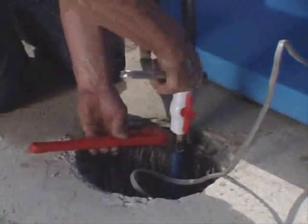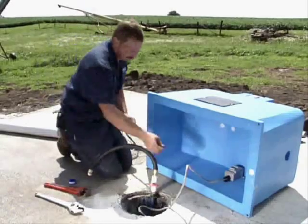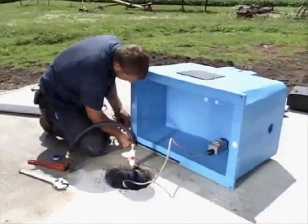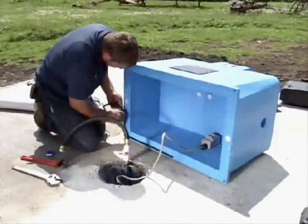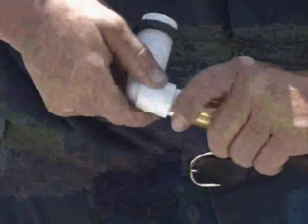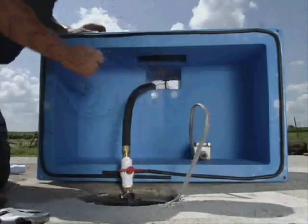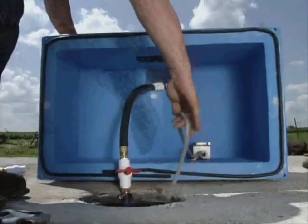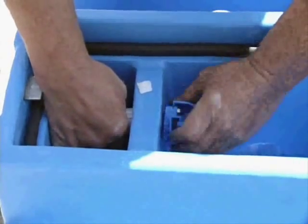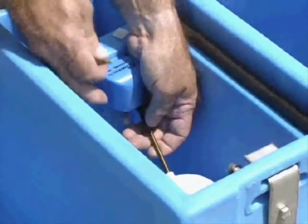Before you set the tank, turn on the water to flush the line out and to check for leaks. Remove the paper backing from the rubber gasket and affix it to the bottom of the tank a quarter inch from the edge — this will keep air out and help the heat well stay dry. Remember, Teflon tape should be used on all threaded ends. Install the PVC elbow onto the supply hose, then place the water line through the opening and into the valve compartment and center the tank over the hole. Push the PVC elbow through the hole and hand tighten to the valve onto the PVC fitting, then attach the float valve to the hose and hand tighten.